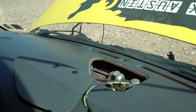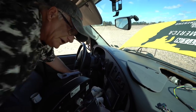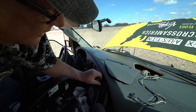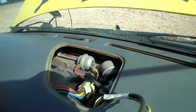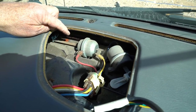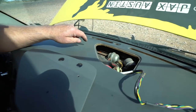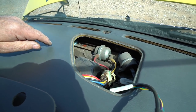So what we do is start it up, give it a minute to build the vacuum up, and then you turn it — it has to be on. That's AC but vent, huh? Yeah, AC. See that right there? That solenoid's moving. Okay, so we go to vent. Let's watch that one. See how the thing works? Oh yeah, that's a noise that I've heard before. That's the vacuum control — and that's working, right? You put it in off and it shuts. You put it on AC and it opens. You put it over on floor and it shuts. So it's working.